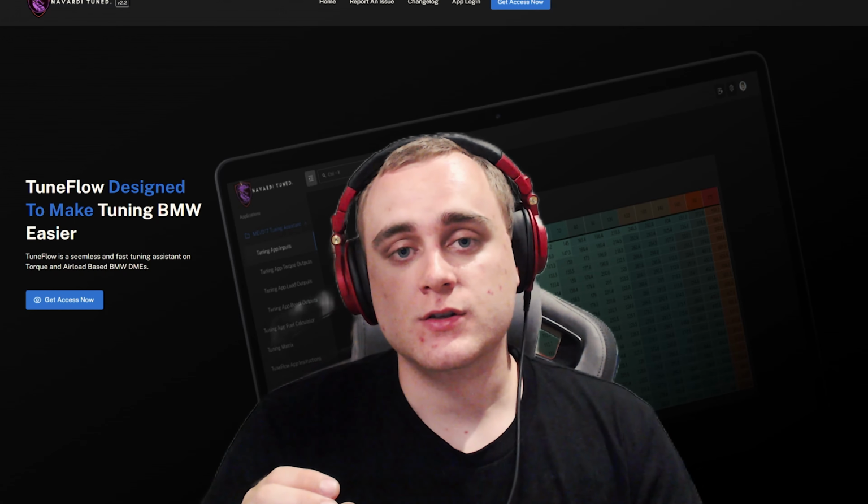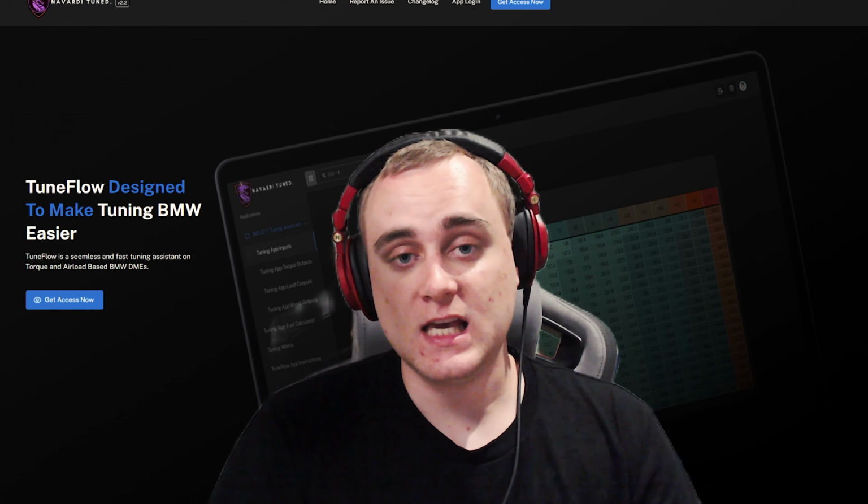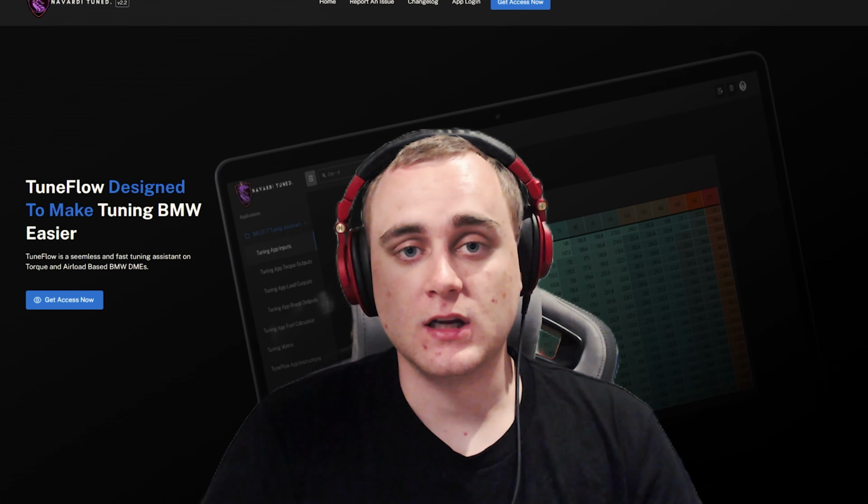It's those sections of the sleeve, of the cylinder, where it takes the most abuse, so you want it to be as thick as possible in that area. The thickness of the sleeve between cylinders doesn't matter a whole lot in this region, but it's still important, though not as important as those other two surfaces, right? Because the conrod is not rotating front to back. It's rotating left to right or right to left, depending on your engine configuration and how you're looking at the engine.